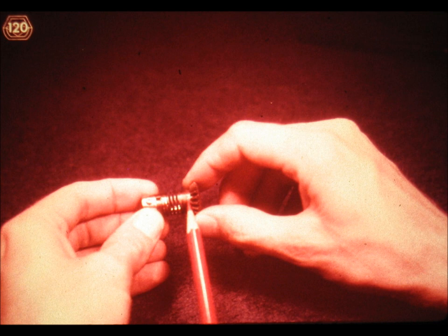Since the operational shaft is constantly turning, the hub has to turn also, while the tabulation governor pinion can only turn if the tab cord drum turns. This occurs during spacing and during tabulation. During tabulation, the tabulation governor pinion will try to turn top to the front faster than the operational shaft. That is when the tab governor clutch comes in. It limits the RPM of the tab pinion gear to the RPM of the operational shaft, thus giving us an even and smooth movement of the carrier from left to right during tabulation.